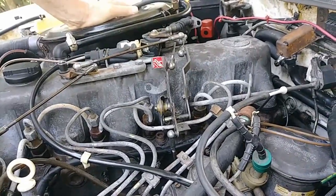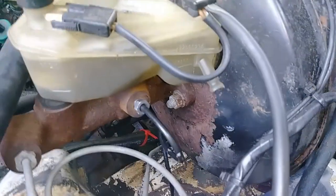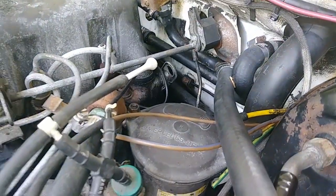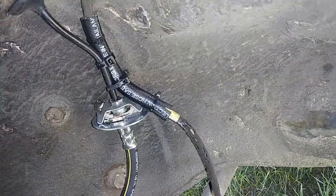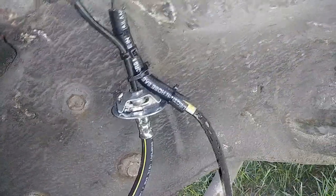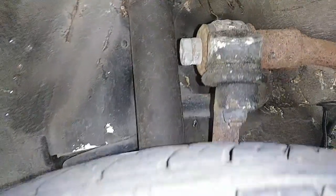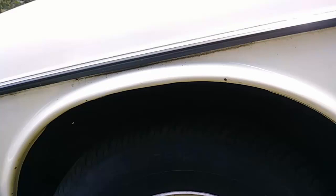This is the new line bent to specs, and this is the other side of the front because it goes around — right there, there are keepers. But on the line itself, the rubber line that comes in is smaller and it wouldn't fit. So I put a washer on it and used a rat tail file to open it out just a little bit, so when it came up to that hole it stopped perfectly.